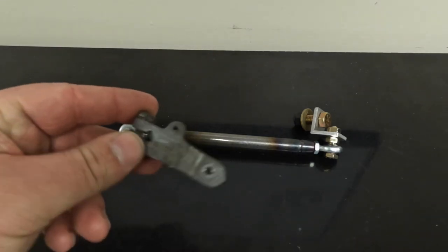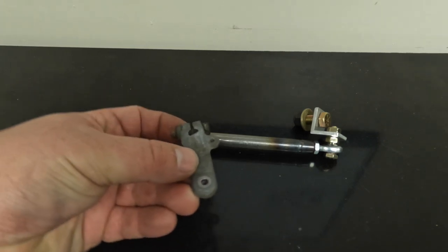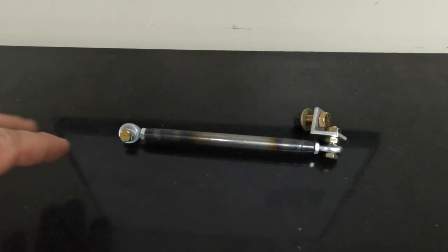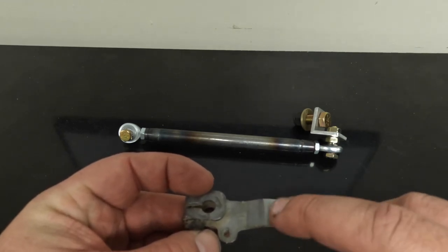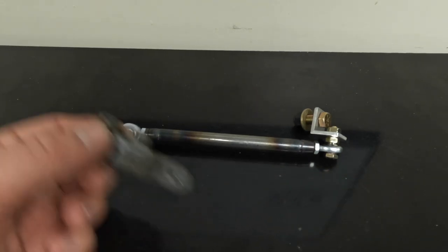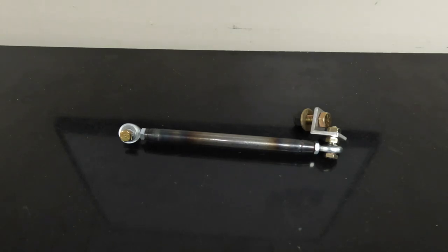What that allows you to do is take your TV lever and put that on the throttle valve shaft, just like a factory transmission would be on a ranging pressure valve body, and that will allow you to dictate where that is in a fixed position at all times. The kit includes everything you see right here. For those putting these on 48s where you do not have a TV lever, I am working on getting levers made. For those that do have levers, the easiest way is to take your lever, flip it upside down, grind the back side of the ball down, and drive it out with a punch. The ball just comes right out, then open that hole up to quarter inch, and you'll be able to attach the TV lever to the adjuster rod.